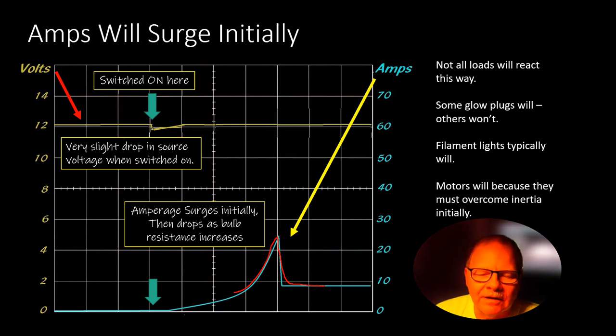On the Power Stroke diesels, we used to be told that with eight glow plugs, if you put an amp clamp and measured the current on all eight as soon as the relay snapped closed, you ought to see 25 amps per glow plug — 200 amps total. As they warmed up, the resistance would increase so current dropped to about 15 amps per glow plug. We did that on the Power Stroke diesels to see if we had one burned-out glow plug, since not all of those had a system set up like the California truck where glow plugs were measured individually.